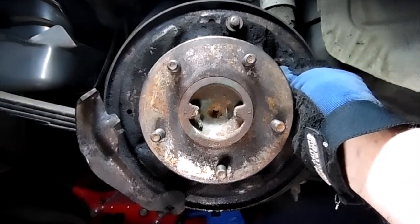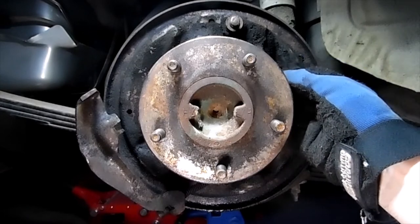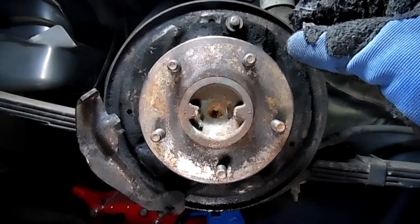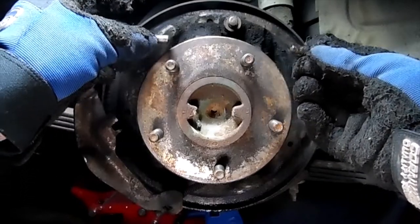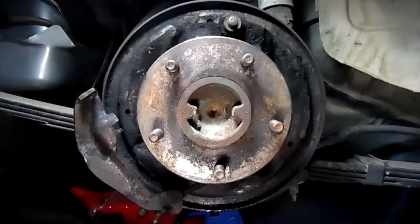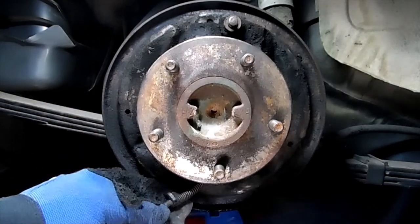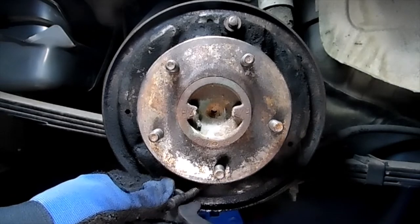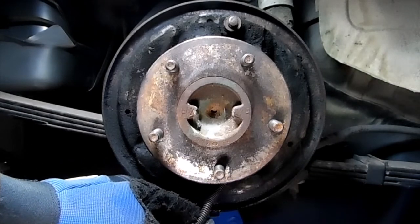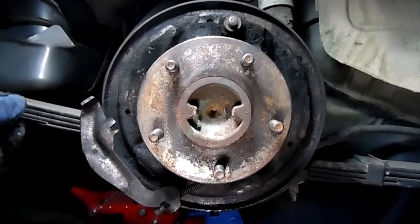And then we're down to our wheel cylinders, which you can tell these wheel cylinders are pretty much shot. You take these little pins out of your wheel cylinder. There'll be one on both sides. The other one actually fell off, so here it is. And we're going to clean these up and reuse these because they don't come with the new kit with the new wheel cylinders. Now, your emergency brake cable comes off right here. We'll disengage that. And then we can reinstall it, everything to the new, and start putting this all back together.